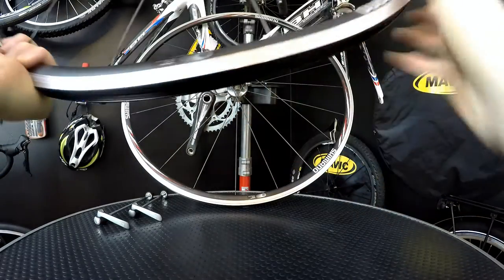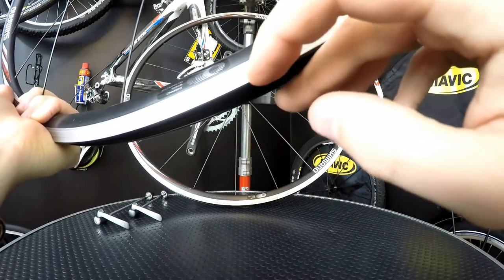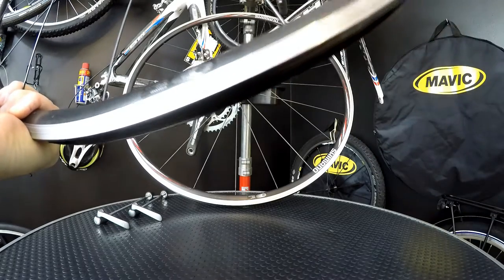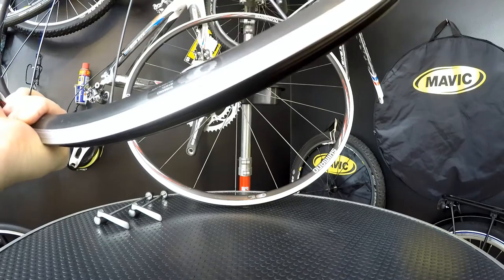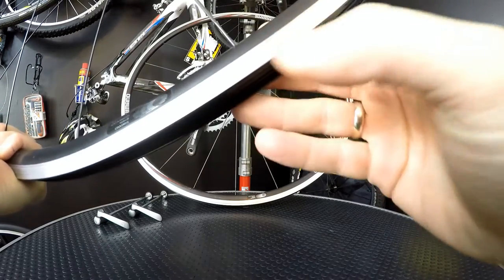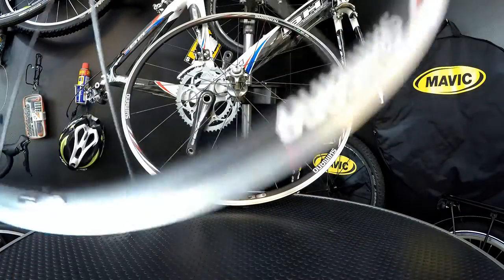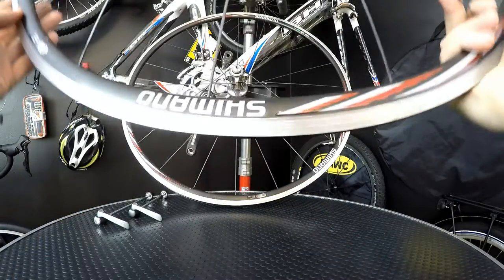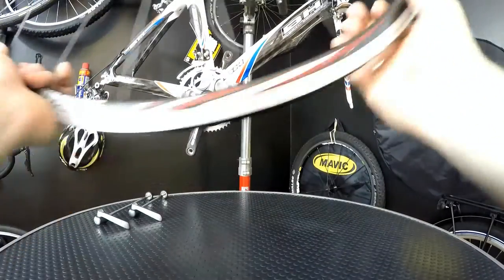On the rim we have a very good braking surface and also wear indicators. When you're buying a used one, don't worry about any dirt in the little hole drilled on the rim — but you have to make sure it's still there. When it's still there and the surface is quite even — and it's very even here — that means these wheels will be able to go for many more rides.